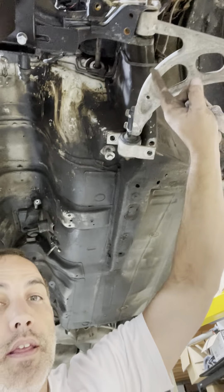So that's my current issue — this mount right here that I need to brainstorm a fix for. Everything else seems to be going alright. The CAN bus data was really good to find, and I'm really excited about the electric rack because I don't want a power steering pump — I want that real estate. I might use it for an oil pump, or put an AC compressor there and move the oil pump to the AC spot. I definitely want to free up that real estate, not have hoses near the exhaust, and figure out what I can do on the other side of the engine. I'm also doing a drive-by-wire conversion on the car so I can have cruise control without the big module, and I'm still going to keep AC in this thing.